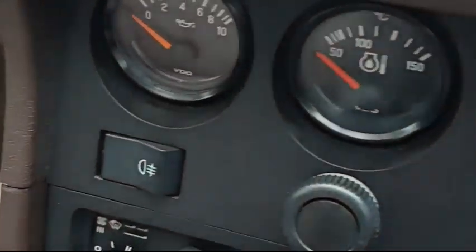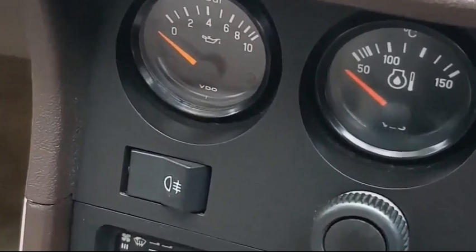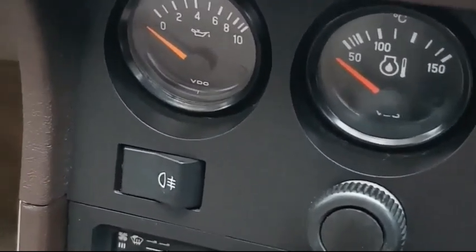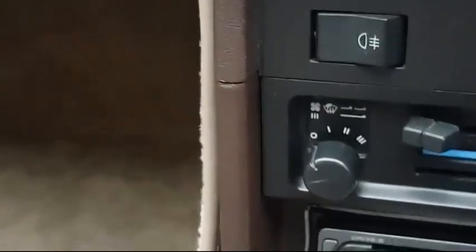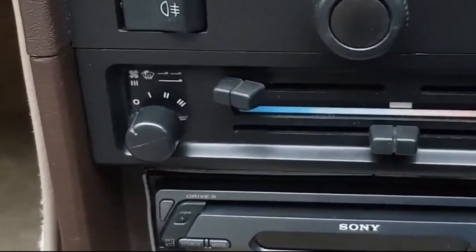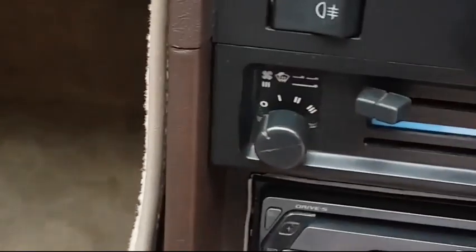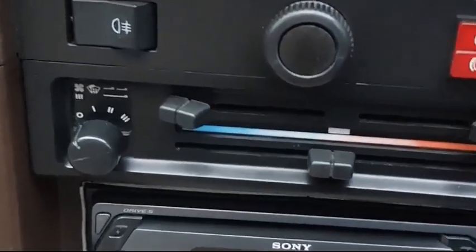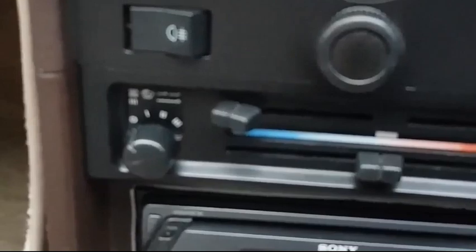That is one of my pain points for the MOT. For some reason the rear fog lights do not want to light, and there's a couple of tests that you can do. Some folks say that the rear fog lights don't come on unless they're on with full beam and with the front fog lights. So yeah, I've tested all that and it still doesn't come on, so it's obviously going to have to be a wiring job.